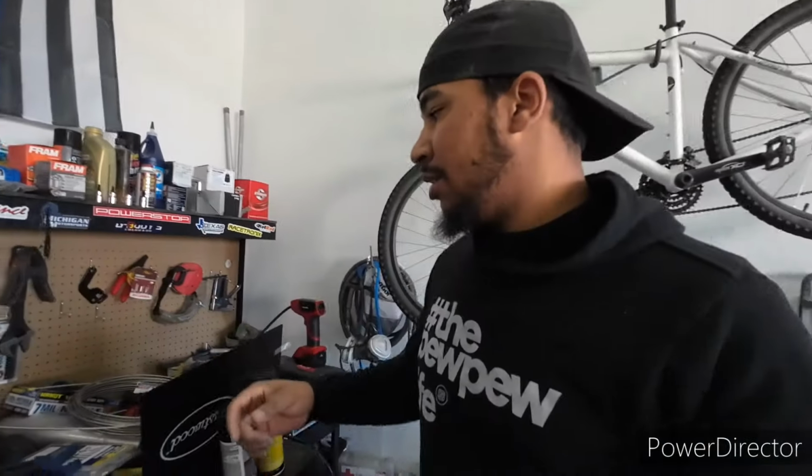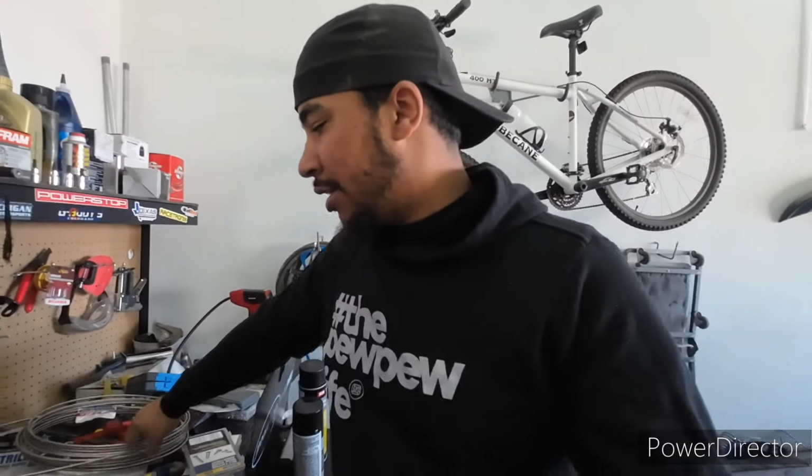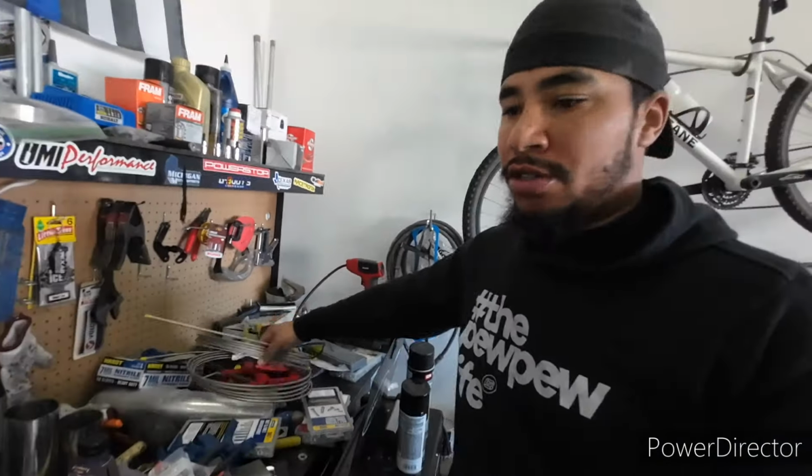And I started looking up some stuff. So the thing I'm going to do different this time is with the quarter inch brake line. I'm going to get rid of that and go with the 3/16 brake line on the rear also. I was looking, and that's why they came with the adapters for those lines on the master cylinder. It came with the 3/16 adapter, so it's kind of saying this is the size you want to use.